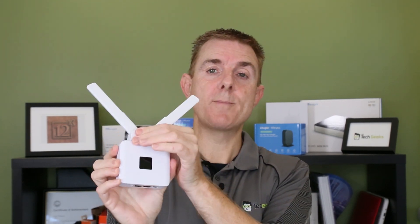This is going to do 4G or LTE and is only rated up to about 150 megabits per second down with a 50 meg upload, so do be aware of that. This does support wireless but it only supports B, G and N — we've got no Wireless 6 and no AC wireless standard. This is not a five gigahertz wireless router; it only runs in the 2.4. What we're seeing is this geared really towards the Internet of Things. It's going to go into a property where you want some reporting — maybe from smart light bulbs, maybe from other reporting devices, maybe just some very basic wireless. You can use this to give you the Wi-Fi you need over a 4G connection, but we're not looking for fast throughput. Why do we necessarily need five gigahertz? With 2.4 we're getting slightly better distance, and why do we need faster speed if we can max out only at 150 megabits per second?